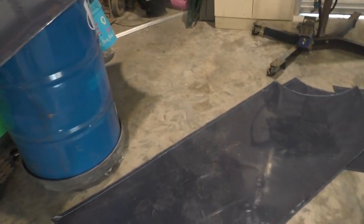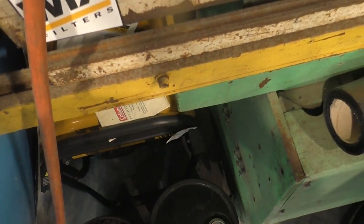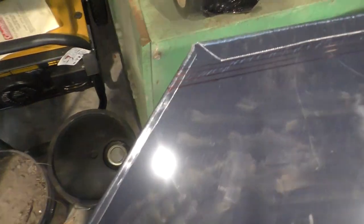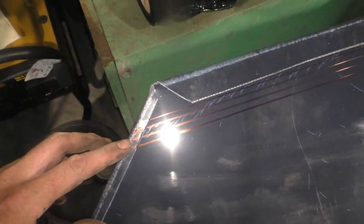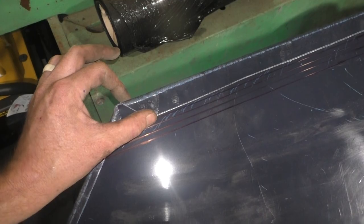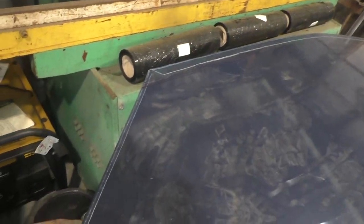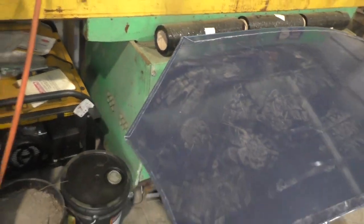We've got both doors and rear quarters hemmed. Now we're about to do our top brake. For this particular brake, you can see it's just a little straight elbow, and I don't want a sharp edge — I want a nice radius. I'm going to have to do a bunch of little bends. I've got four marks here to give me a little bit of a radius rather than just a sharp pointy curve. On my seam, I always like to give myself about an inch seam top and bottom. Bottom, that way you have your angled piece that your skirt goes on — it's just got an extra layer of sheet metal on top as well. Your rivets will go through it, gives you a little extra layer, and all around it's just going to make the whole panel that much stronger. The more brakes, the stronger it's going to be. Let's go and break our upright.